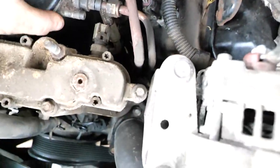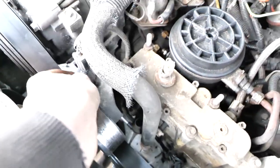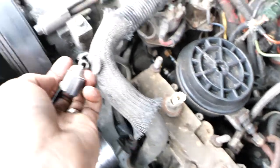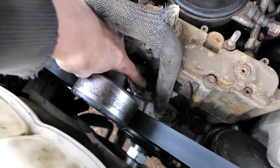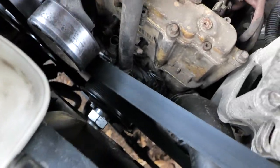There are two 13-millimeter bolts, one here, one here. I disconnected the exhaust back pressure sensor line — this is it right here, the purple. That's the sensor right there, but that helps you get to it a little bit easier. And that's got to get disconnected anyway.